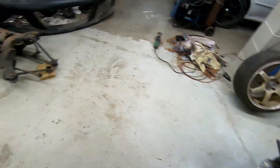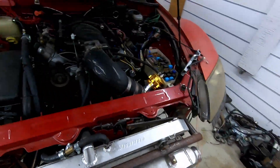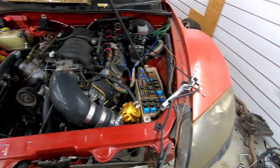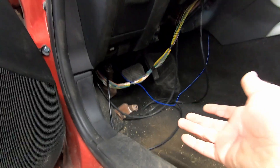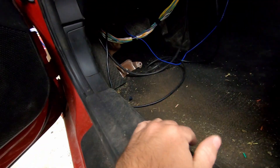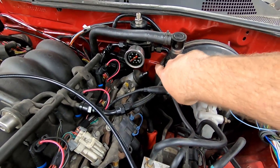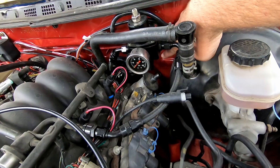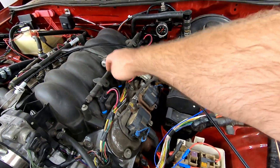Battery is charged. As you can see, the twin turbo truck is gone from the last video. Need to dispose of the subframe somehow. I need to pull the gas pedal out of inside the RX-8 — it's still in there, still need to clean it. So I need to pull out the old gas pedal, tuck up all the wiring, mount it, and then see where I need to drill a hole through. Because obviously this car is fly-by-wire, not cable, so the hole will probably need to be somewhere in that area. A lot of people on the forums have it right here on the corner. I believe I have plenty of cable to S-curve and mount it up on some of these pieces on the fuel rails.